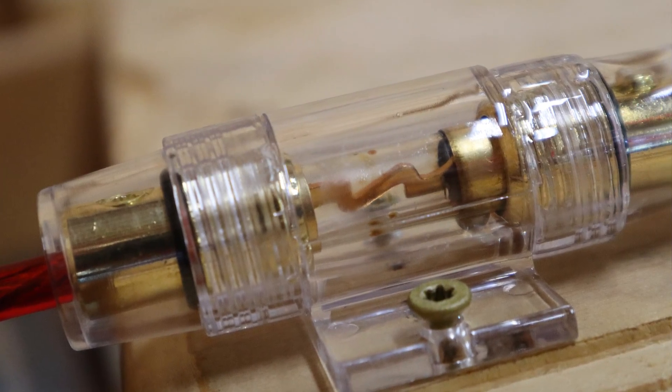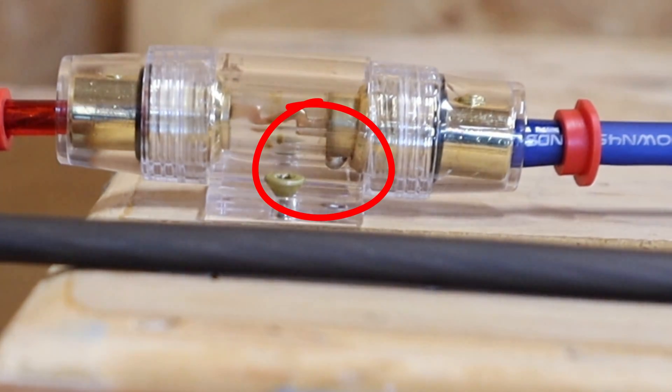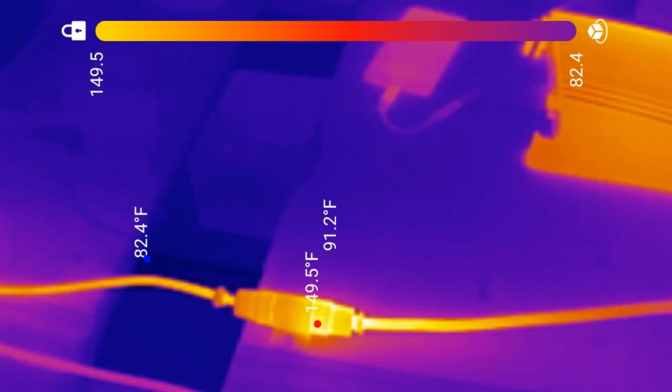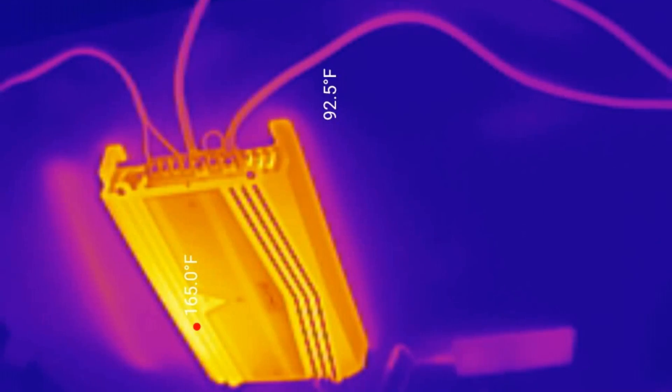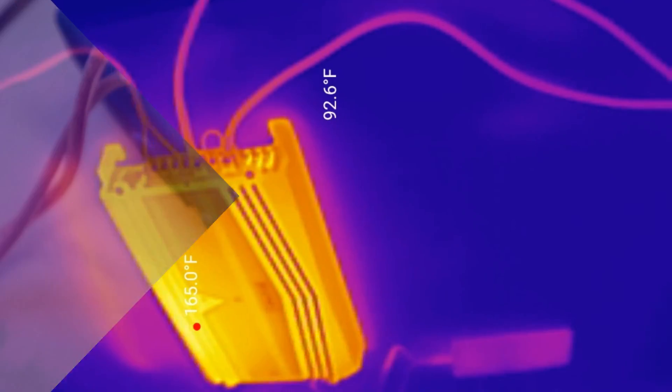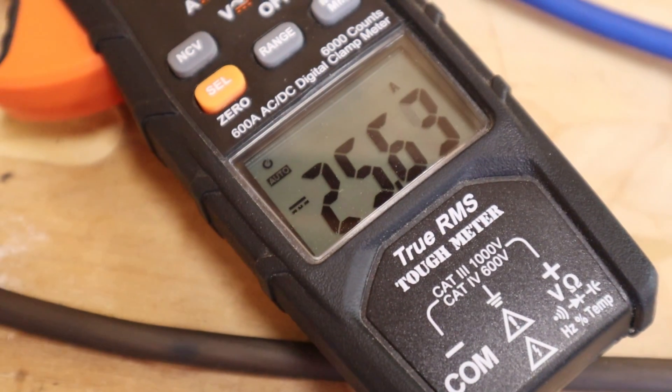Back to the fun part — let's see how our fuse holder is holding up. We've been running this somewhere between 15 and 20 minutes and the fuse in the holder looks a little burned. There's a little drop of solder at the bottom of the fuse. I had stepped away for a few minutes so I don't know exactly how hot it got. On the thermal we're hanging out just below 200 degrees, which doesn't seem hot enough to melt things. Turning to the amp, it's up to 165 degrees, and on the amp dyno we're down to 225 watts.